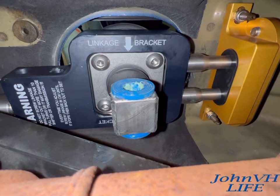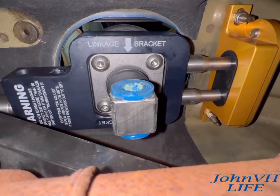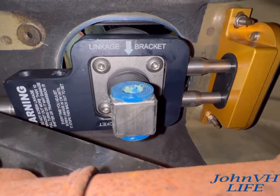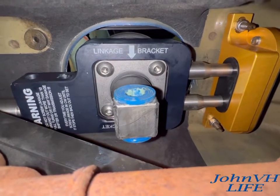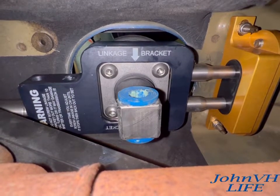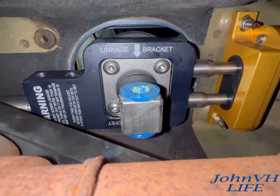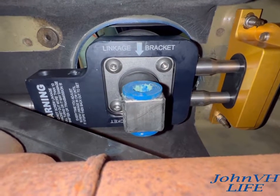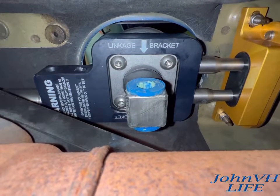You have to set the adjustment — screw it clockwise all the way in. I'd suggest doing this before you install the shifter because it's a pain down here and some parts of the thread don't turn real easy. Crank it all the way in clockwise, then back it out — the video shows about four turns — and you've got to end with the arrow pointing to the driver's side. That's what I did; it came to about three and a half turns for me. It says not to do more than 10. It's adjustable throw so you can dial in what you like.